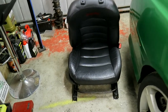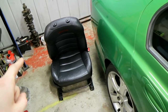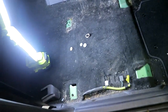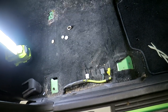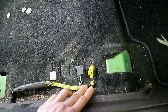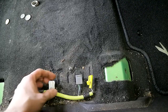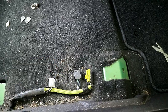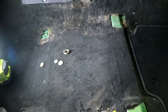There you can see we've got the seat out. I popped that headrest off to give a little bit more room and tilted it forward — that seemed to work quite well. The four seat base bolts come out nice and easy; they were T50 Torx bits. Do those first, then lean it back a touch and it'll make it much easier to get the wiring connectors out. The yellow and the white one have the little clips at the front — they're quite easy to get to. That grey one has the clip at the back that you need to push on, so tilt it back; it'll make your life a lot easier.